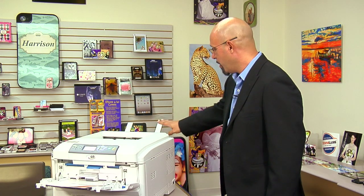A few other things we want to know before we get started. When it comes to running transfer paper through your Laser Imprints GoUno, you always want to run transfer paper from the multi-purpose tray, not the cassette tray down at the bottom. Also, you want to make sure that you have your back exit tray opened. That way the paper path is straight in, straight out, and it will significantly reduce your chances of having a paper jam. Now let's get started with what causes paper jams.